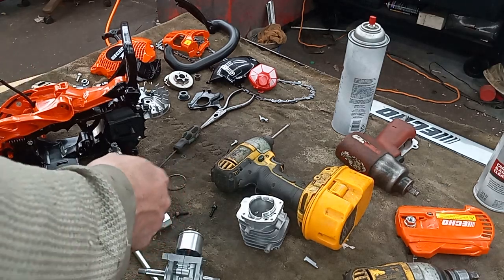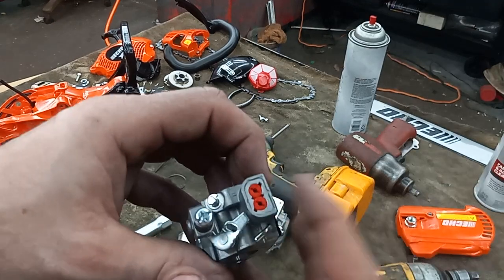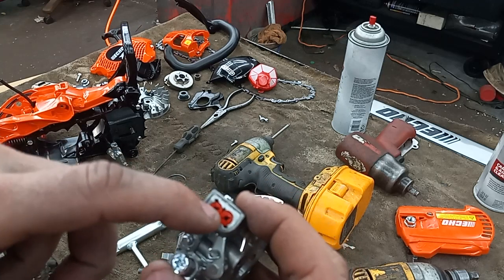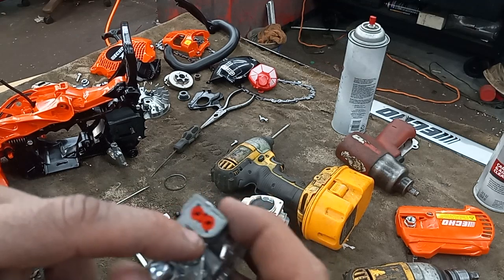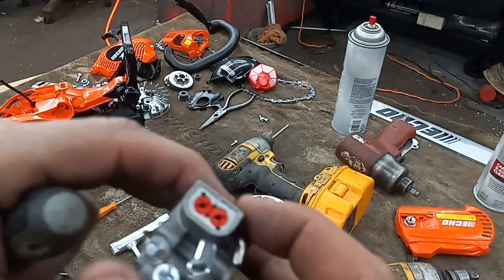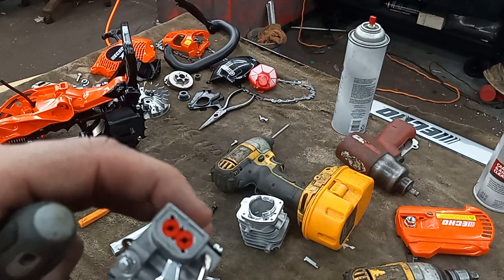Let's see, what else was there? Oh yeah, on these I see, well, they come in here. If you pull these caps, put them back in, just trim the tabs off, put them back in, it makes adjusting the carburetor while it's running so much better. And I've seen, you don't have to cut this off or pop that aluminum retainer out.